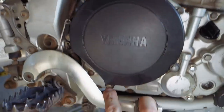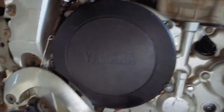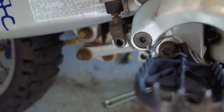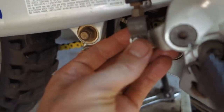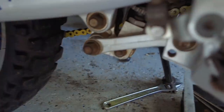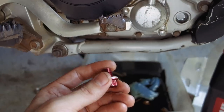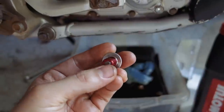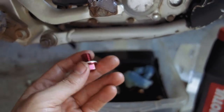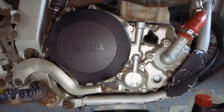Put the clutch cover back on - two bolts there to start, then the rest. Now we're just going to put the brake back together - flip that back, easy as can be. Pull the cotter out, put the clevis pin back in, put the washer back on, and grab your cotter pin. Put the oil back in the bike. If you don't have one of these, consider getting a magnetic drain plug - little gear shavings get stuck on it, it's just a nice extra safety measure.